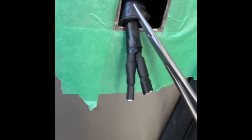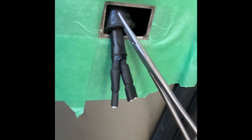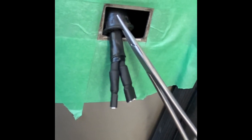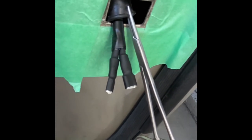What I just realized is that I've gone through and done this whole job of crimping everything, doing this whole fantastic thing, and I don't know which wire is the positive wire now. The red wire is the positive wire and now that I've covered them all up completely, I have no idea which one it is. Lesson learned — next time mark that down with a pen or something so that you don't have to undo all your work. Luckily all I had to do was unwrap my electrical tape just to see which one's the red wire, and it's that one there. I'm just going to mark that off with a piece of tape so I know when I go to connect everything back.